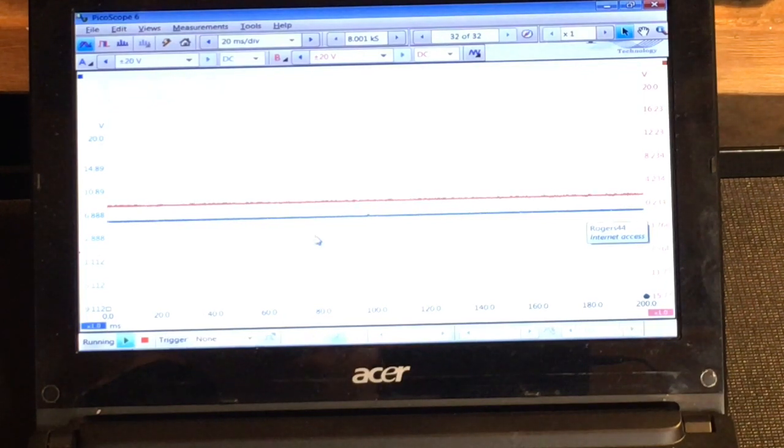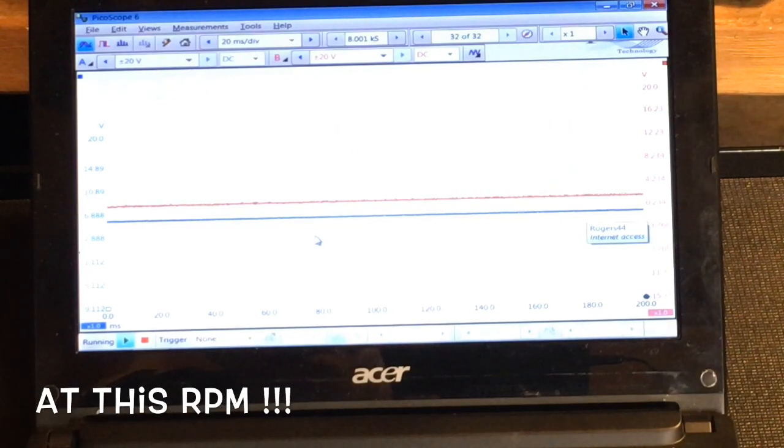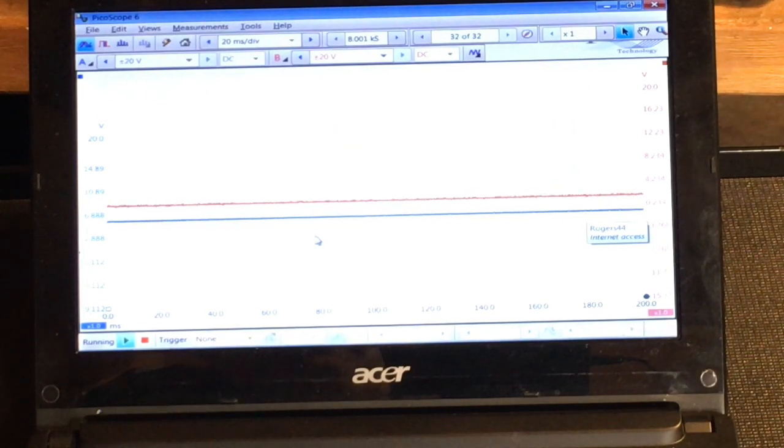All right, well, I didn't expect that either. Looks like the feedback line has gone basically to a solid low. Yeah, it's still functional. I didn't expect that either. So that's pretty much, I think, the alternator balls to the wall. I'm only at idle here and I'm asking a lot. So perhaps that does make some sense. So let me drop the load again. I've got everything loaded up and we'll see if we can make some sense of what's happening.